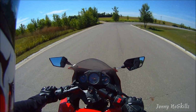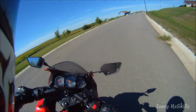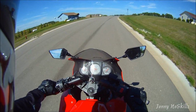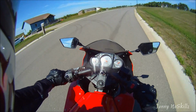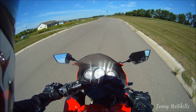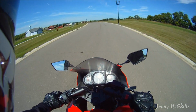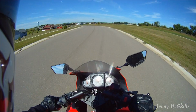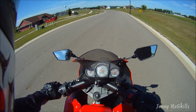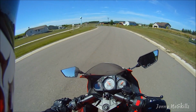So let's upshift to this. Alright, we're going 4,000, but we're going a little slow. Or we're going 5,000 RPMs right over there. I want to shift down, so I let go of the gas, pull in the clutch, shift down, match it back up to 5,000, let off. It's like that. That's how I do it. I'm sure that might not be the right technique, but it works for me.